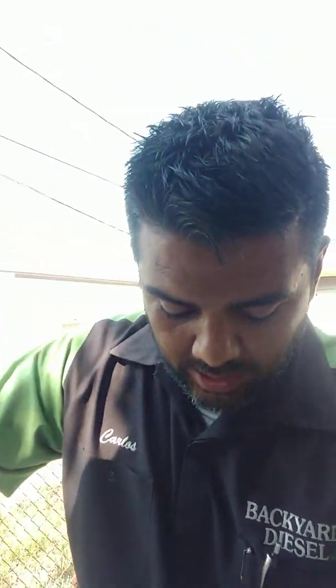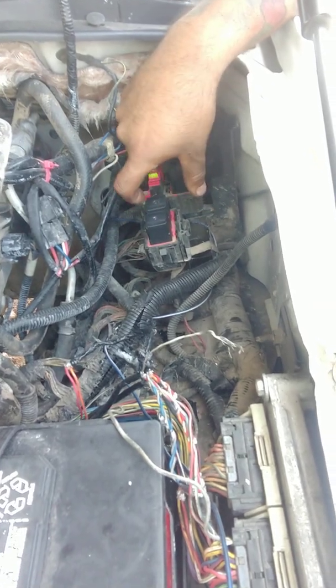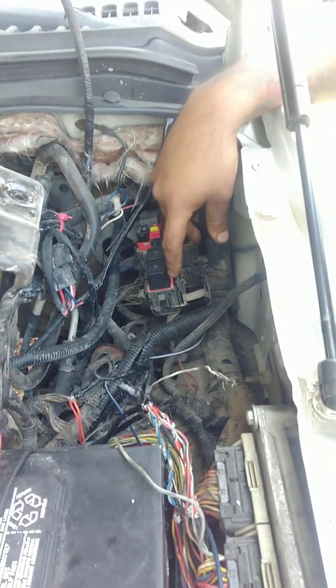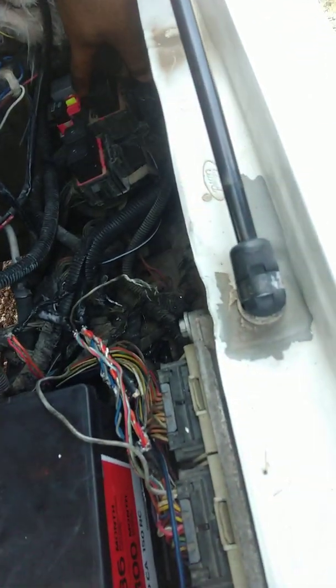There you have it. Hopefully this helps and that's your problem. That's a no-name FICM, a four-pin FICM that I keep in here — but that's another story. If you're having this issue, always look on the Ford 6-liters — there's always a fatter gray relay on this side, and one for the driver module inside. Check the fuses — tens, twenties, I think there's a 15. All this is good. So: grounding issues on the 6-liter. When I replaced the FICM the truck ran fine for a month — that was it, that was the problem. Appreciate you guys!